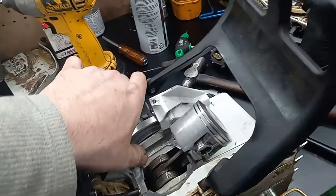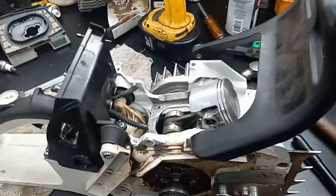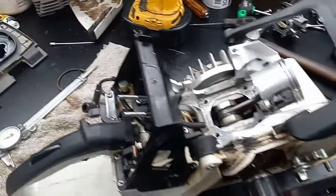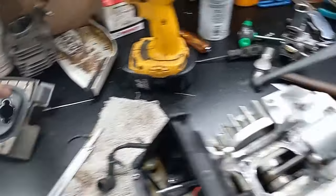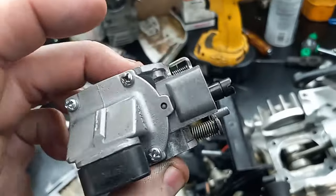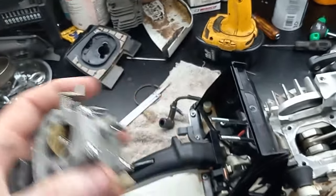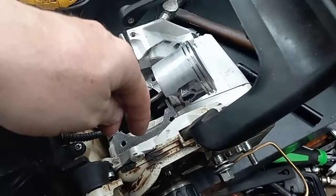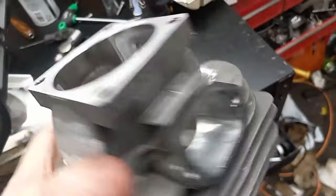I'm getting quite a bit of piston rock in this. It won't have the black covers on it anymore because I used them on a different saw — but I've got a set of orange ones, I might dye them black or I might just leave it black and throw the orange ones in there. I can't remember what carburetor I had on this thing — looks like I had an OEM carburetor on it. I think this is one I built out of three of them, but I had to do a lot of clearancing to get everything to fit like I wanted it to.